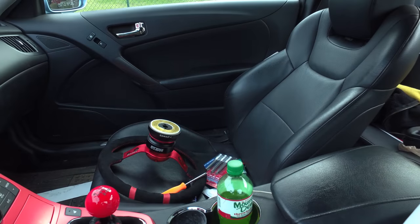Hello everybody and welcome to today's video. Today we are finally going to install this steering wheel that I've been staring at for the past few days — it's been sitting over there in the seat just waiting. First thing I did is disconnect the negative terminal on the battery; it's been sitting for about five minutes now.